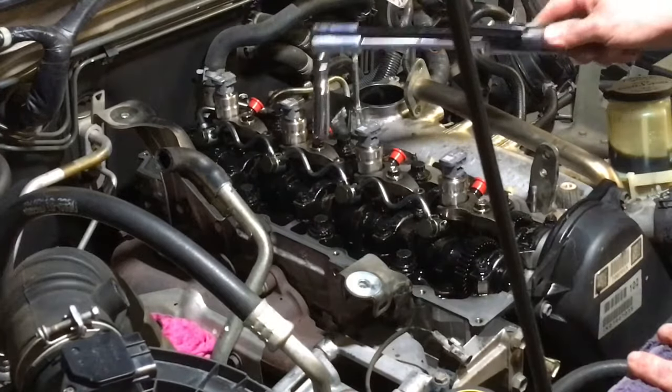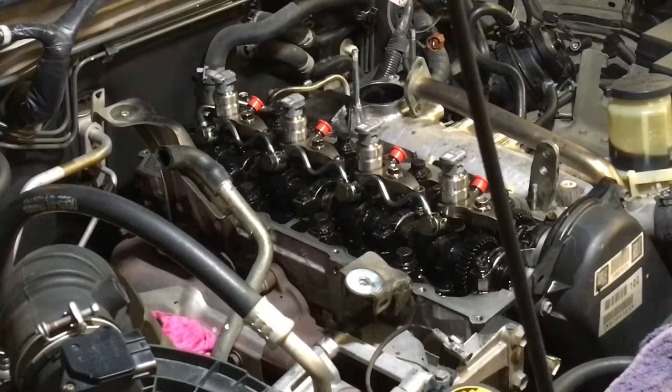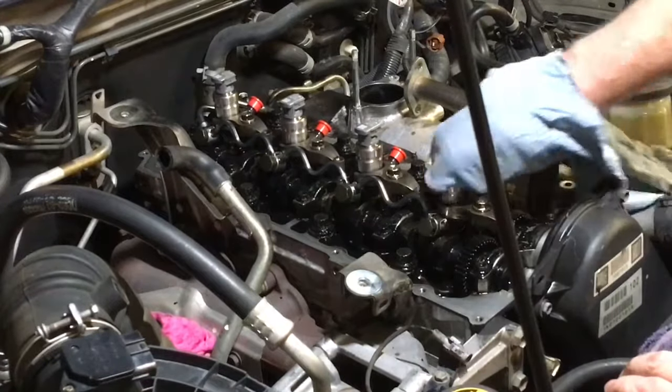Right, these clamps. Because if you over-tighten them, as we've explained before, you're bananaing the injector. So how simple is that? That's putting the seats in, putting the injectors in, they're all lubed up, making sure the alignment's right, torquing those to specification. Just make sure it's all nice and clean, the solenoid and that.